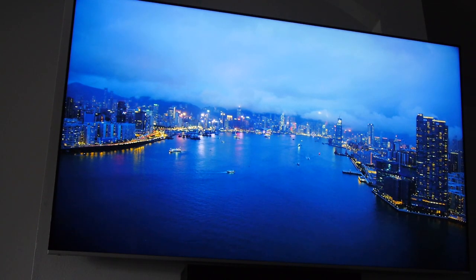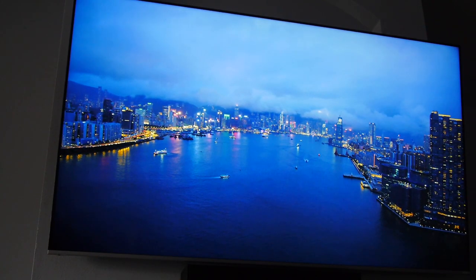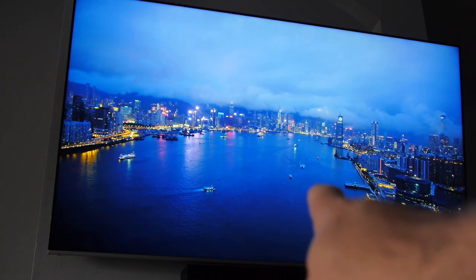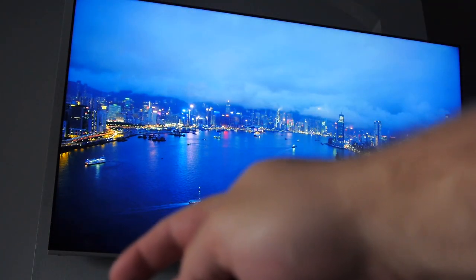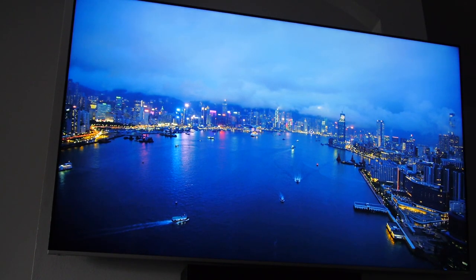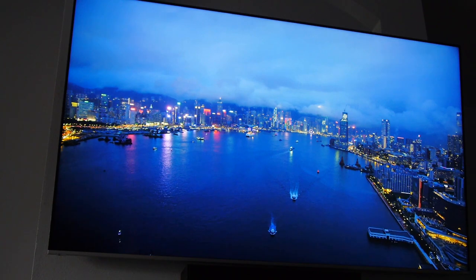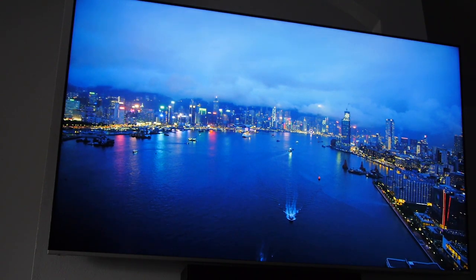My goal is to get the best video: 4K with Dolby Vision, or if you're working with HDR10, that means 4:4:4 chroma. The one thing you're going to need is a really good HDMI cable. I have a 25-foot run going from the TV over the fireplace down into the receiver rack, and it took me several tries to find a cable good enough to pass the bandwidth. This is a fiber optic HDMI cable — cost about a hundred bucks on Amazon. I'll put the link below. Just get the known good cable.